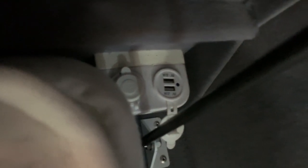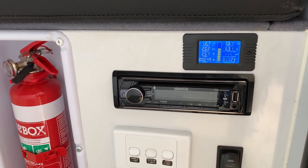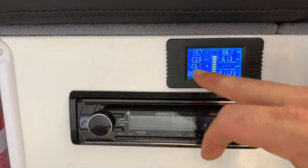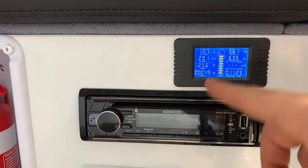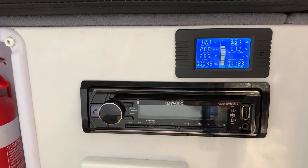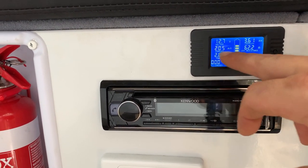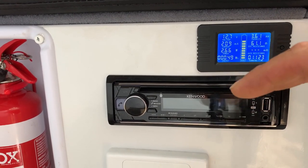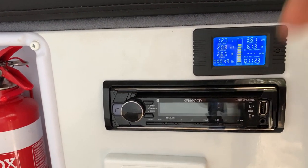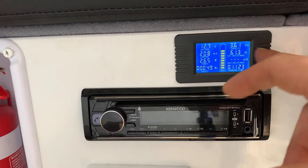I've added either side of the bed a dual USB and a 12 volt outlet. I've also added this — it's only been in for a couple of days so it's not showing the best stuff and there's no sunlight, but I've put a current shunt in on the output of the DC-DC charger. This will tell me how much my solar is putting in. The reason I did that is because I've added an extra solar input, and I want to make sure — because the charger is limited to 25 amp — I can see here what I'm getting in. On a crappy weather day, or if I'm parked in the shade, I can add a solar blanket and plug that in and make sure I'm not going to overdo the charge. This was like 25 or 30 bucks on eBay — cut a rectangle hole and wired it up.